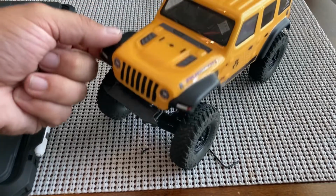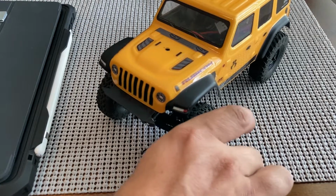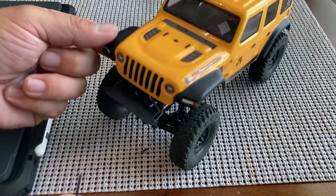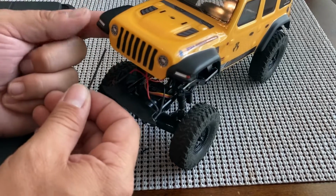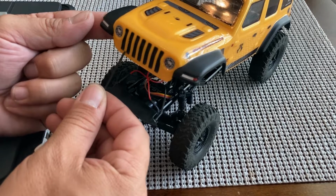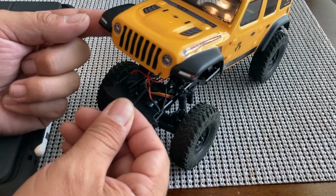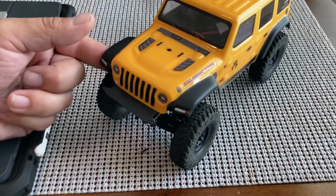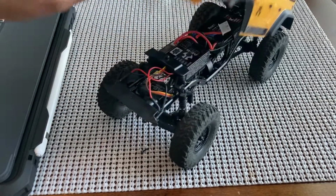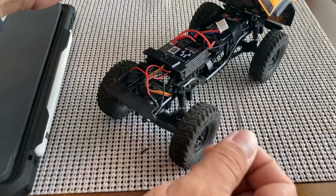All right, now that you've got that bumper flipped and reinstalled, you're going to notice that the body will not close the way it did from the factory. So what you're going to need to do is trim across the bottom so it will close up nice and tight. I find that right below where the grill slats end is about the right height. Start conservative and work your way in. Use a sharp pair of scissors. I find the best is actual body trim scissors.